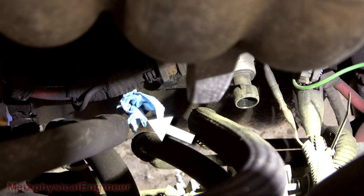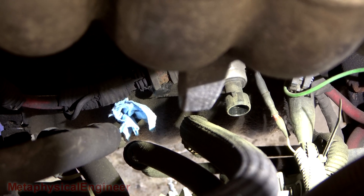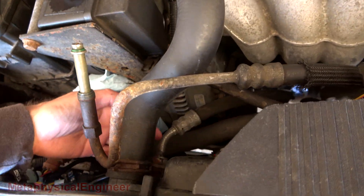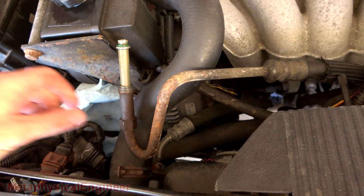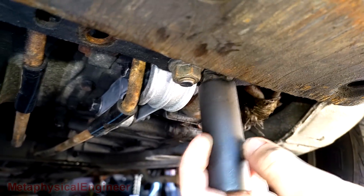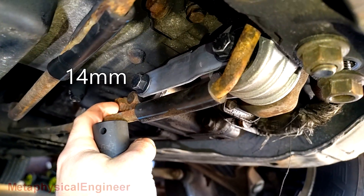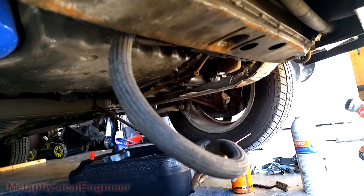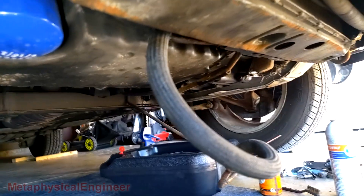Pulled out the dipstick and dipstick tube and unhooked the connector for the oil pressure sensor. The stock oil pressure switch is a little bit lower profile so that step may not be needed. Worked the high-pressure line under the upper radiator hose and above the upper oil cooler hose — a little bit of a tight fit, but it will work out, just a three-dimensional jigsaw puzzle. For more maneuvering room over here, I'm going to pull the lower transmission torque mount — two 18mm nuts up at the subframe and two 14mm bolts into the transmission housing. Torque mount out of the way gives a whole lot more room for the lines to move. Working the flexible part of the line down out of the front of the engine compartment to allow more angles to get it clear of the rack.